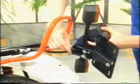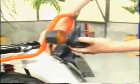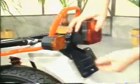Mount the pre-assembled license plate holder with washers to the mudguard. Fasten the cables by means of clamps and cable strips to the frame. Plug the cables to the related terminal boards. Consult the wiring diagram and color code. Connect the brown cable to the earth terminal.